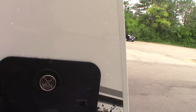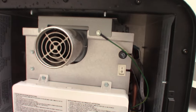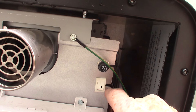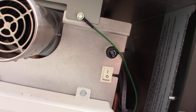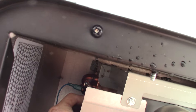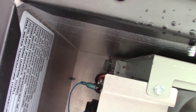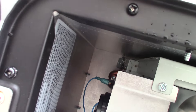This has on-demand water, which is a great thing. This is your on-demand water heater right here. Two things you should know. This is the master switch — right now it's on; it's just a rocker switch. You also have a fuse, but that will rarely blow — good to know it's there. Right back here, it's difficult to see, but there's a black button between those two blue connectors — that's a kill switch as well. If it throws error code three, odds are you just push that and it'll reset. It's something you'll rarely have to do, if ever, but it's good to know it's there.